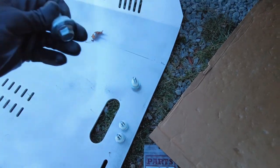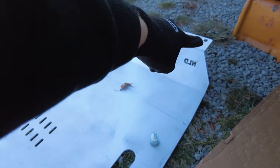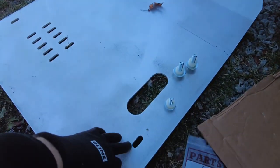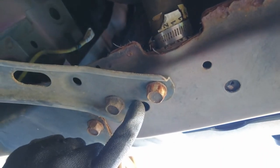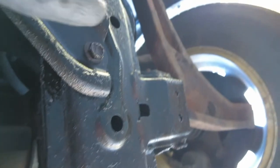You're going to get two M12 10.9 grade bolts for the front of the skid plate, and then you're going to get two 10.9 grade M10 bolts for the rear slots on the skid plate. The M12s go underneath here — you're going to take out the innermost bolt on both the passenger and driver's side. Those come out and that's where you mount the front two. In the back, you're going to grab this front bolt here and over here.